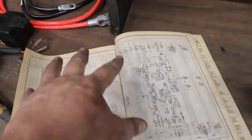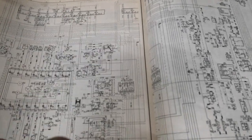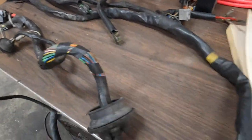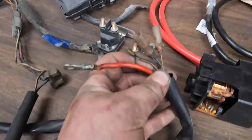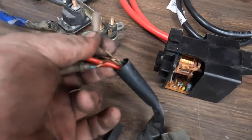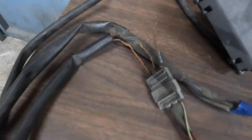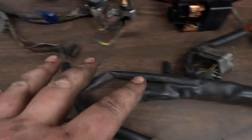The Haynes manual is kind of a mess and hard to use, but if and when I need to troubleshoot, we'll get into that. Just using my eyes, I can see some things that need fixing — like the old glow plug relay plug. Those bare wires aren't so good. That's probably why the fuse melted out of the fuse box. Lots of corrosion, lots of broken insulation, missing terminals — all that. So just visually, I'm going to redo this.